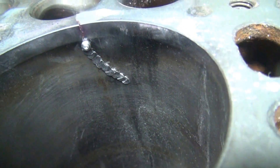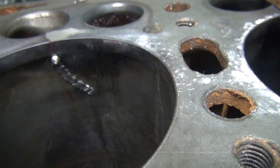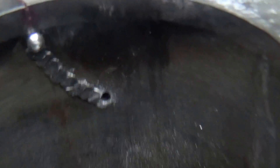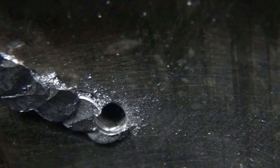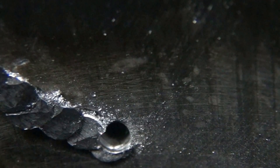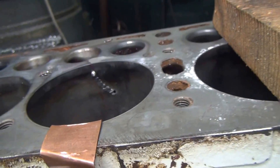But first I'm going to go down here and put another pin right here — one or two more — just to make sure I've got that crack stopped. I looked at the video and it looks like the last pin was right on top of that crack, so I'm thinking about hitting that again. I went ahead and dropped down to the next hole, but the drill just walked right down on top of the pin that was there and drilled about 75% of the original pin out with only a little bit of cylinder. So I don't think we're going to be doing that anymore — I'll go ahead and tap this out with my long tap.